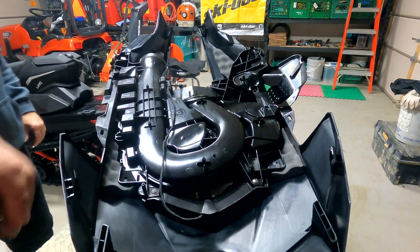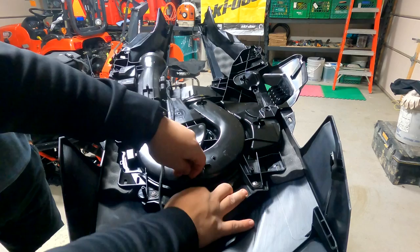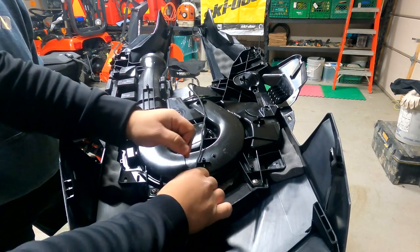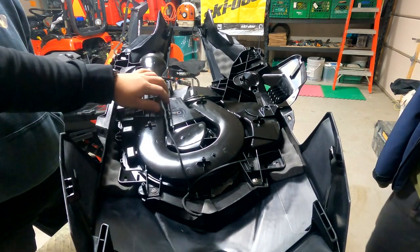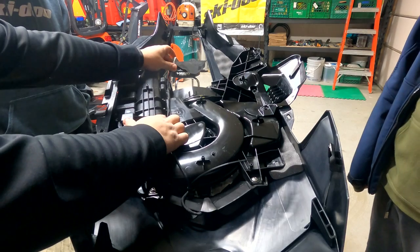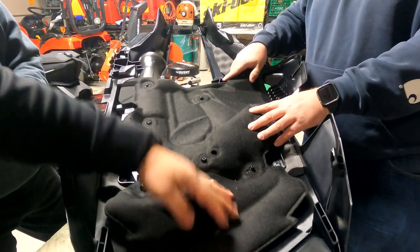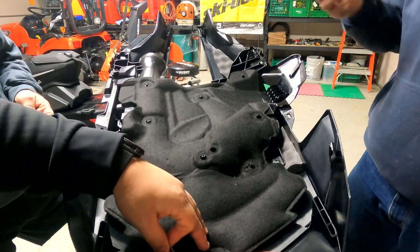Now that we got the wire routed through, you have a little area here where you fasten down the wiring. I'm not going to tighten it down fully, just to guide where we want the wiring. This wiring is going to go under the heat shield, and it comes right over here where it's going to connect into your wiring harness on your machine. Now that we have that wire in place, the heat shield is ready to go back on. They give you new metal washer things that clamp them down, so we're going to go ahead and put those back on.